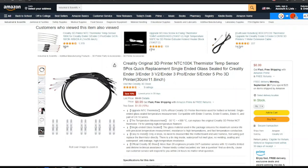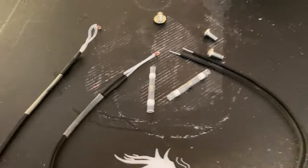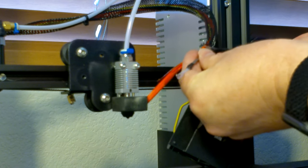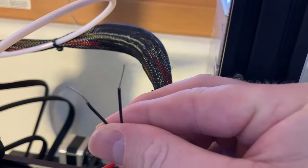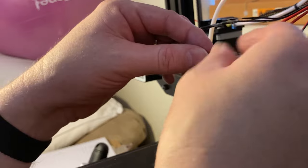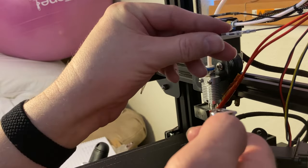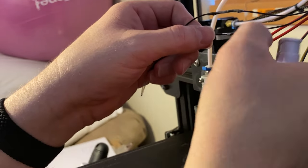The replacement kit I got is for splicing a new thermistor in — there's no need to pull out the entire wire assembly from the motherboard. I'll have a link in the description below for the exact one I used. With this kit you simply cut the old thermistor off, then cut the new one a little longer than the old piece just to give a little extra room to work with. Strip both ends off of the wires you just cut to expose them. Use the supplied joining sleeves to connect the wires, then simply heat them up with a heat gun or a lighter and they melt and compress together creating a splice. Be careful with the flame — too high and it can melt the joiner. Do not ask me how I know that.